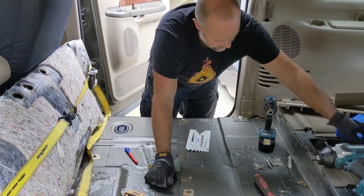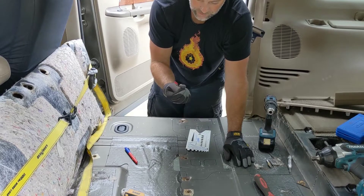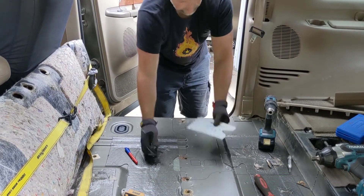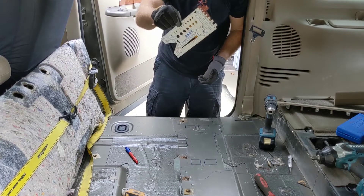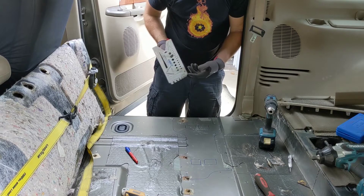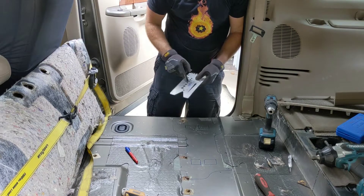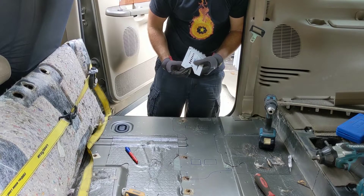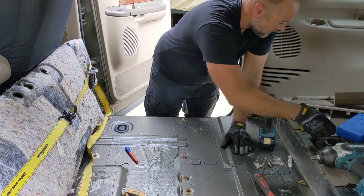Some guys say they can get a regular Torx to work. If you don't have rusty bolts it probably will work, but I would bet that if there's any bit of rust on those, or anything gumming up the threads, you're going to either destroy your Torx bit or the head of that bolt pretty quick. Another thing I use all the time — especially building the race car — is this little gauge. It's got metric and SAE size bolt holes, millimeters across the top, inches across the bottom. This is an M12 bolt in the floor for the seats. I'm going to end up with half-inch holes in the floor just because my step bits are all imperial — not metric — but not a huge deal, just a little bit of clearance. That is a super handy little tool to have if you deal with a lot of nuts and bolts you don't know sizes on.